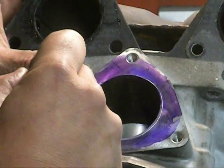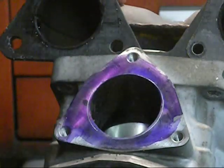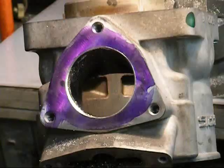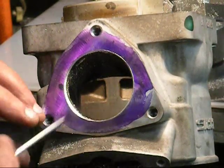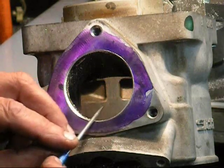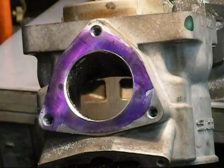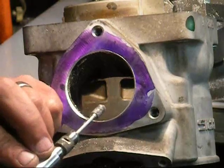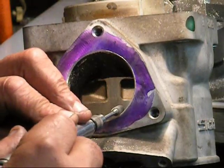You can see there's a lot of room to make this thing blend in together — so that's what we're going to do next. I went ahead and followed my scratch line, and you can see I got an angle about like this. I'm going to blend this way about 10 millimeters — a little bit more than 3/8 of an inch. I call this an anchor — I like to have an anchor down, and I'm just going to get it in this way now.